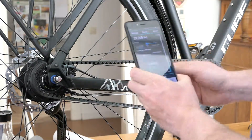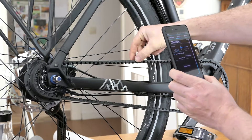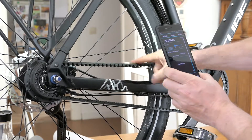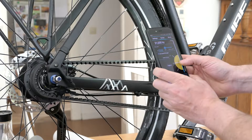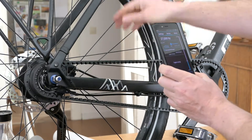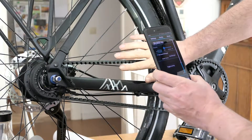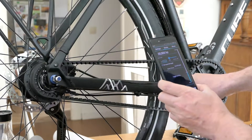I go to 29 Hz and now I see a picture of this belt — when it's up and when it's down. When I shift the frequency a little bit, I see a wobbling effect. There is a small bow in the belt, so that's not the right frame rate. When I go too far down I get the same wobbling. When I have the right frequency, there is no wobbling — the belt stays in one position or two positions. Now I see it here, and the belt stays — 30 Hz is right.